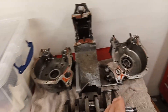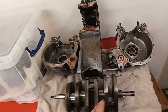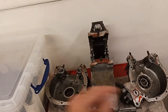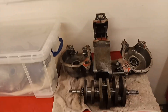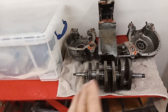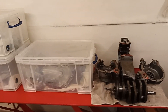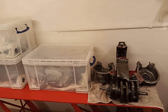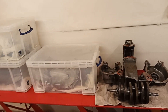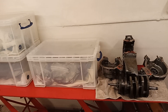The engine is all stripped now. I'm going to clean it up, and on camera we'll clean out the crankshaft, check all the journals, check the bores on the cylinders, check the pistons and all wearing parts, and recheck that exhaust camshaft. Once everything is checked we'll decide whether we're rehoning, reboring, replacing shells, and so on. Hopefully the next video won't be too long - life is busy but as soon as we get a chance we'll clean up and get on with the checks so parts can be sent to the engineers.